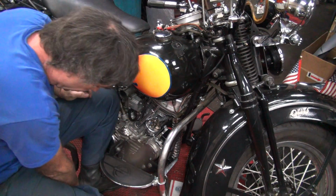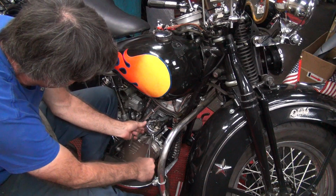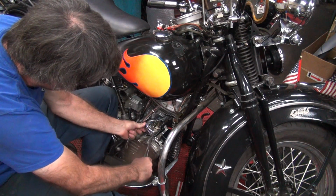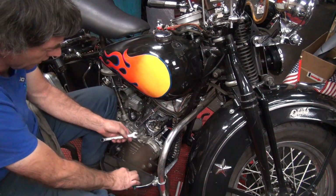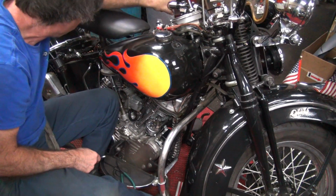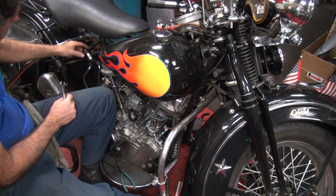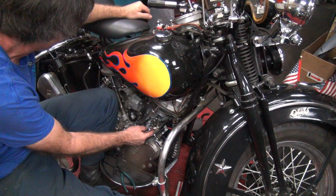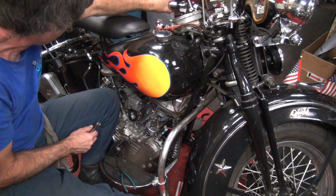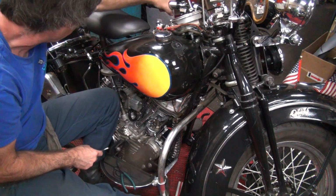If I put my finger down there, I'm going to bleed, so I'm going to use this thing right here. There you go. I already know the position I want the distributor moved to. Of course, he doesn't want to move. Okay, I'm on the other side of the hole, so there's a major adjustment. Tighten it back down. Ignition's still on. I heard it. Can you see the spark at all? Yep, there it is. There it goes, right at the stop. Yep, that's perfect. Right at the stop is where it does it every time.